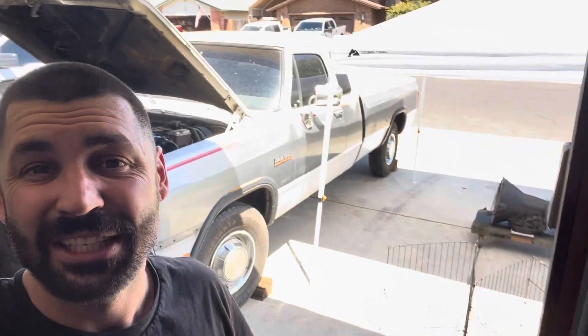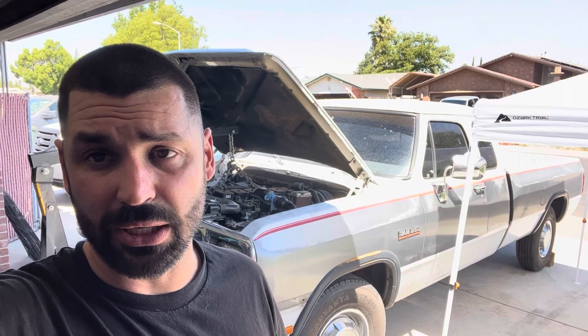Welcome back to the garden's garage. We're here with the first gen — got the new 47RH transmission, cleaned it up and painted it. I was doing the rear main seal on the 12-valve motor and when I pulled that plate off the bottom, the oil pan gasket — the original gasket — pulled up with the plate. So to do it correctly, I'm replacing the whole oil pan gasket. When I bought the truck the guy told me the pan was leaking, so it needed it already. I didn't want to RTV it, put the whole trans in, and have it leak later.